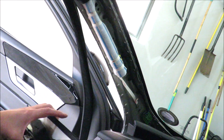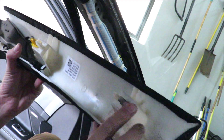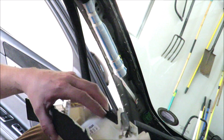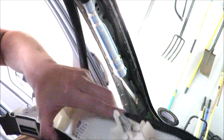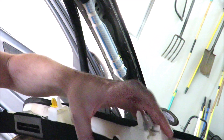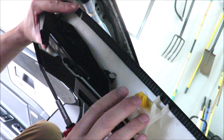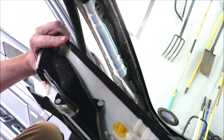I just want to show you guys — this clip over here is quite a thing. What you've got to do is stick a screwdriver through the hole and you can then press it against the clip on the inside to release it. Just twist your screwdriver — it must be a flat screwdriver. Just twist it like that and it will unclip quite easily. This one you're going to need a trim tool to wedge in between the body of the car and this plastic piece, just to release these because they don't come out very easily.